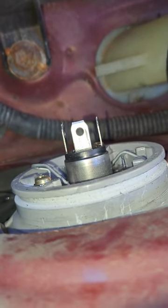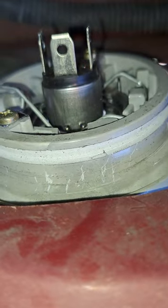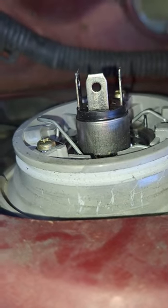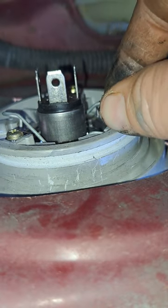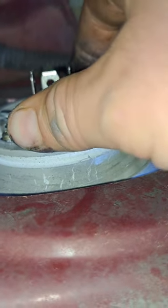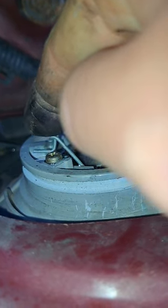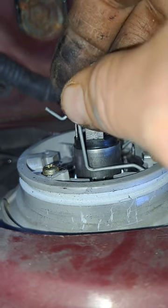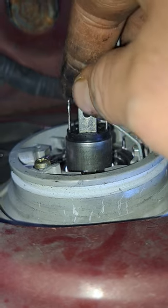There you're going to see the bulb prongs and a wire retaining clip — it's basically an elliptical oval wire, and it's going to end right here on the left. You're going to want to take your finger, depress it, pull it up a little bit, and that will relieve the tension that is holding the bulb in place inside the housing.